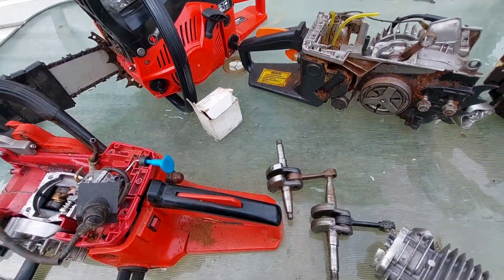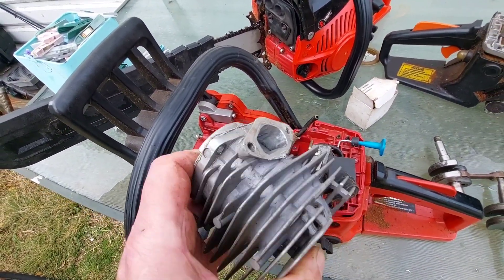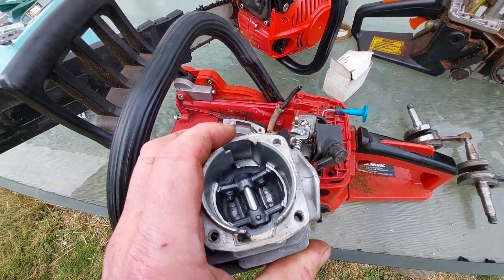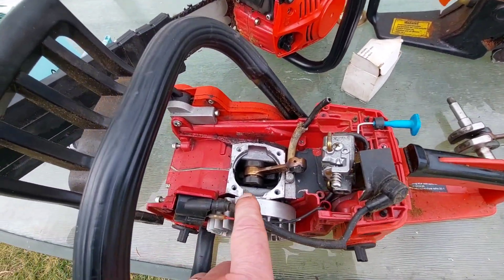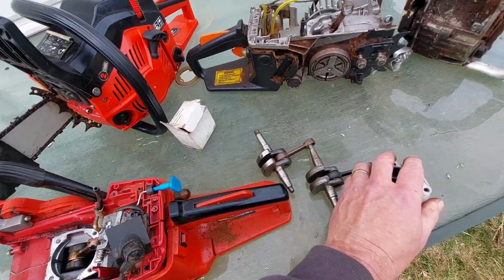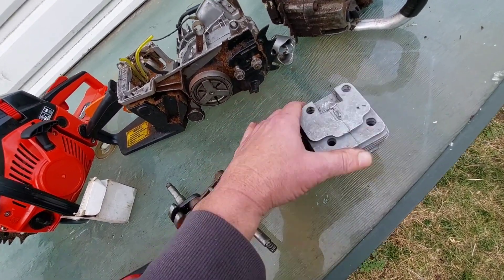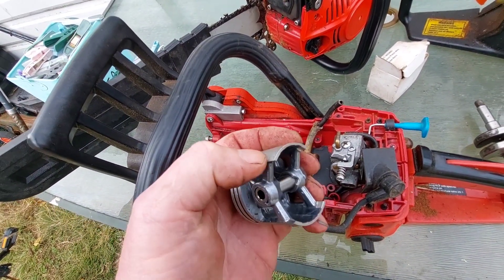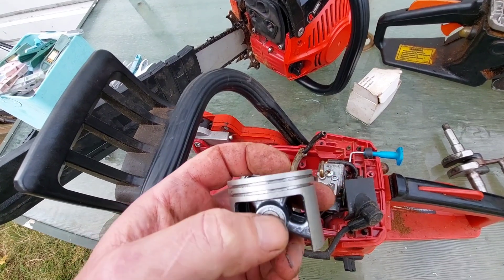I'll have to use a base gasket. It should be very, very close — should be about 25 thou squish, I imagine. It will work really well, and that won't let the thing shake itself to pieces. Because the guy was saying he's getting over 200 PSI of pressure. If we do this, anything I might have to worry about being a shorter stroke is the skirts on the piston — because it's not going all the way up, it's going further down. On the wrist pin, that might have a problem going into the crank — I might have to adjust the skirts just a bit. I think it will work quite well. This piston is higher than the factory but the skirts are the same length, so it's very close.